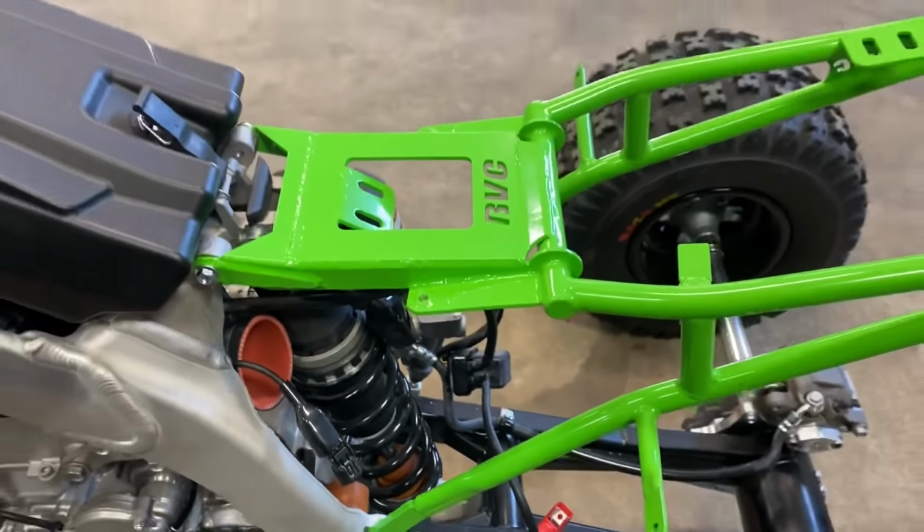And we've got the battery box installed. Now I'm gonna go ahead and make a new ground wire for the negative terminal. This is the factory one, which you can loop to ground, but just being that this is a pretty thick powder coat, I don't wanna have to grind any off. I'm gonna go directly to the motor. That's the best option for these. This is a KFX450R seat latch, factory from Kawasaki.